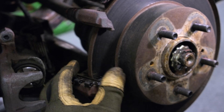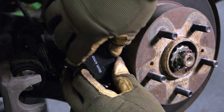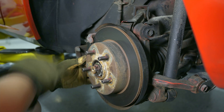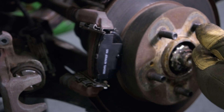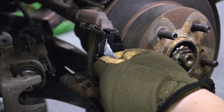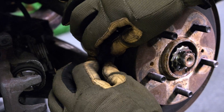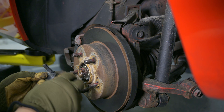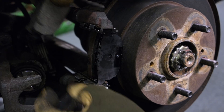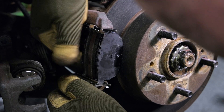Now we're going to place these retaining clips up top and on the bottom. We're going to start with the outside pad — essentially you're trying to get these little ears into the channel here, and this is a frustrating thing to do. Now you take your rear brake pad and apply lubricant to the back and smear it around. We apply some of this grease to the outside pad, then apply the front shim — there we go, that's the front shim in. We've applied the grease to the back pad and we're going to apply the back shim; there are little tabs that clip it on. Once it's nice and snug, we take that pad and put it in the back here — it's not always the easiest to get this thing to play ball, but there we go.